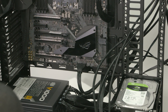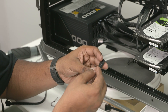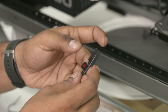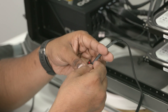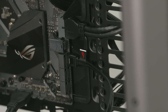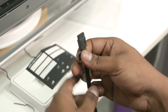With that done, let's connect the SATA cables. Take one end and, pressing in the metal clasp, slide it into the slot on the motherboard. Route the cable through the slot and to the back of the case, then plug it into the back of the HDD. Same for the second hard drive as well.